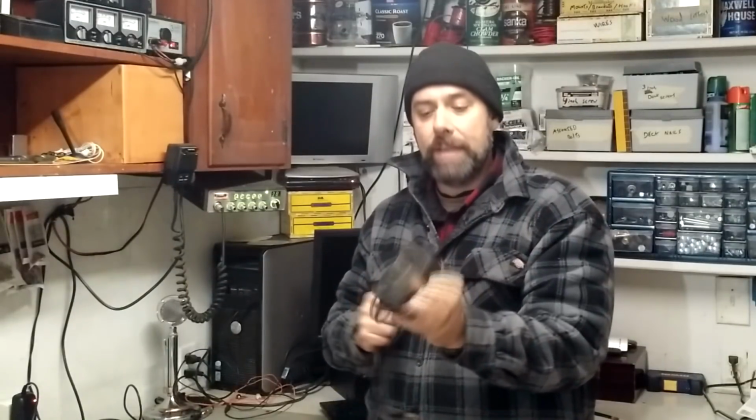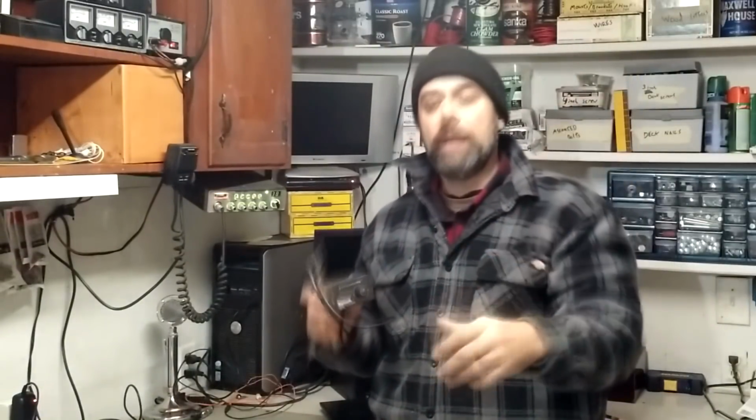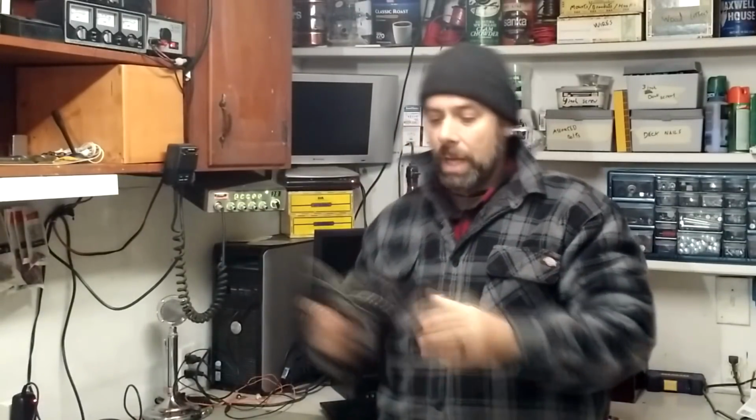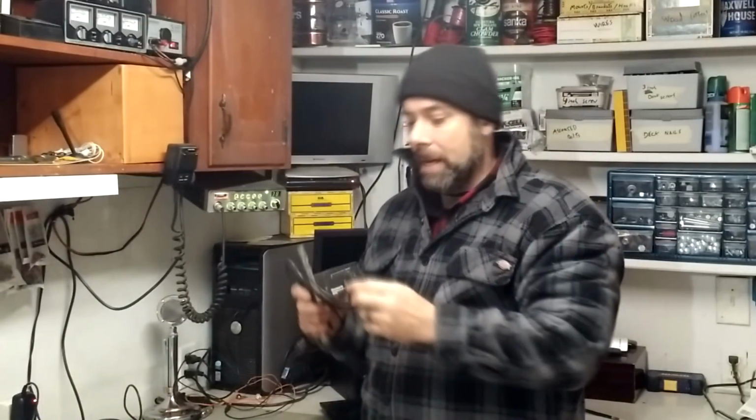Of course, there is one giant downside, and that is that it's not designed specifically for either task. You have a radio antenna that's not really going to be very tall. The average car radio antenna was maybe 20 inches, 24 inches at most back in the day. And your loading coil, which would be your base-mounted, mid-mount or even top-mounted loading coil on a CB radio, is actually going to be here, and that places it inside the vehicle. So the amount of power that actually makes it out into the world when you're transmitting is greatly reduced. When you have to match a signal so it's compatible from this radio's frequency to an AM/FM antenna, you're matching it by reducing the amount of power that goes out. A lot of it gets lost in a device like this.